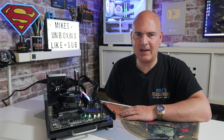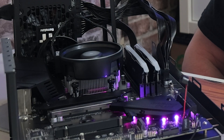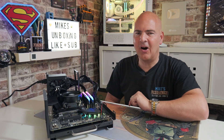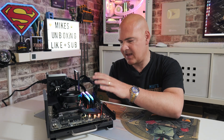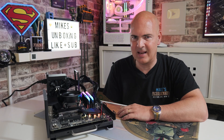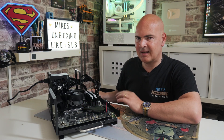Let's stop messing around. Let's put both sticks in properly and see what happens then. Now we've got both sticks installed. The last time we used this motherboard, we had it set up with XMP set to a different system. So although the RAM sticks are physically installed correctly and in the right slots, the BIOS doesn't detect the RAM because the BIOS settings are incorrect from the previous time. We need to reset the CMOS to go back to our default settings so we can then potentially enable XMP. Again, this is highlighting the usefulness of a BIOS bleep speaker. Now it's all installed correctly — let's see what we get now.